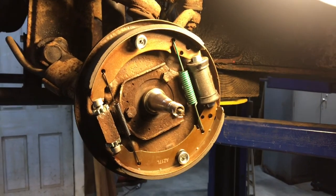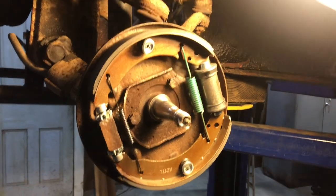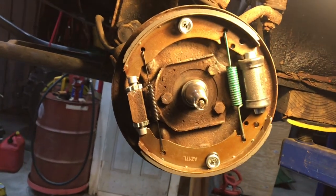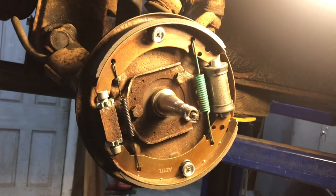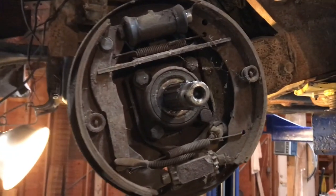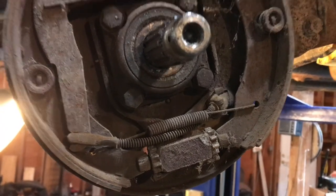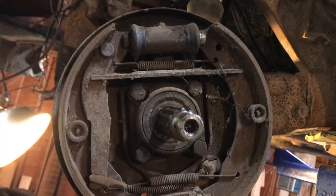Well, it started raining — side effects of that hurricane — so you might be hearing that in the background. But brakes are all up, looking good. I'm going to go clean up the drum and get that wheel bearing re-greased, slide the drum back on, and start adjusting — get it roughly adjusted. I don't like how the e-brake cable is routed under that spring — I think it should be over the spring like it is on the other side. But the brakes look pretty good.